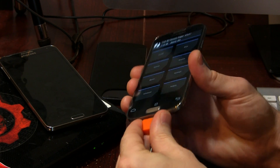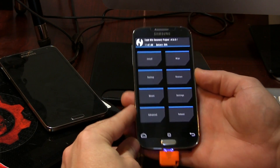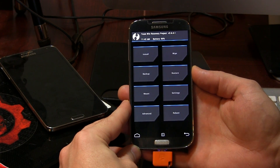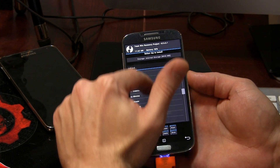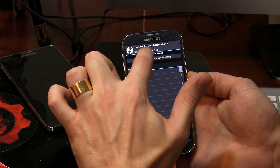If the backup is finished, we can go ahead and double check that we actually have the file on our device, because the last thing we need to do is wipe our device clean before we flash the ROM, then go to look for the ROM file and it isn't there — and then you're going to be in a little bit of an issue. So I'm going to be plugging in my USB OTG adapter where I store my microSD card, and I'm going to wait for the recovery to recognize that. So I'll go into Install.